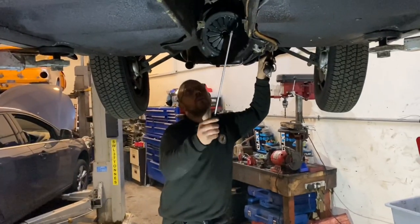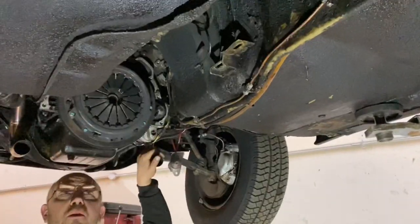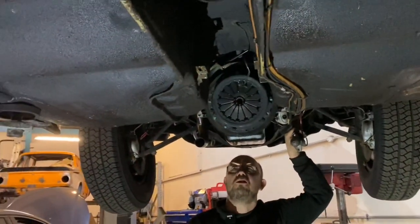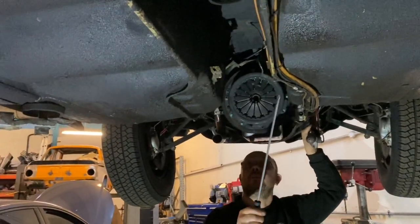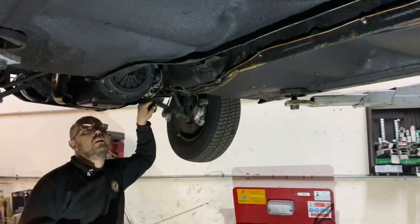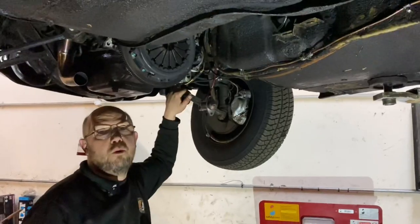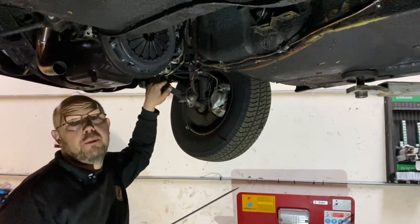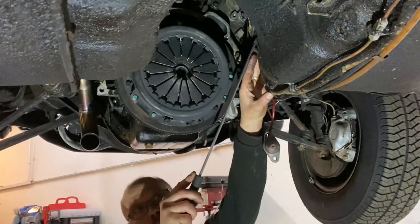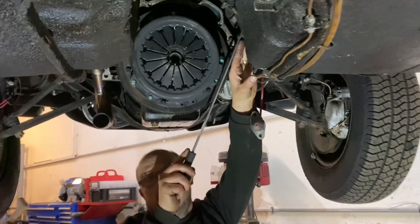We're currently under the P6 and here's the transmission tunnel. If you are converting an automatic you're in luck because it's an easier job - the automatic tunnel is wider and taller and it's a much easier fit. If it's manual you've got a bit of work cut out. Even a four-cylinder gearbox is a very tight fit in a P6 tunnel, particularly around here. A lot of people resort to beating the tunnels up with a hammer - you don't need to do that.